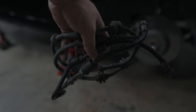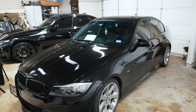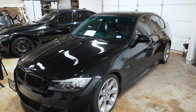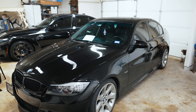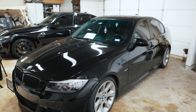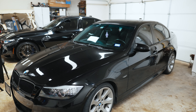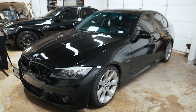I just got back from a test drive and I think it's safe to say there's definitely a difference — I didn't really expect as much as I got. You basically don't feel much difference under regular pedal travel, but when you hammer it the car tends to nosedive with a firmer pedal and it feels a little bit more secure. That could be attributed to the age of the brake lines being replaced or just flushing the fluid in general, but overall I did feel a difference and I was expecting to tell you guys that I wouldn't. Anyway, if this is the first video you're catching of mine please consider subscribing, and if you liked it please give it a like to help me rank better. Thanks for watching.